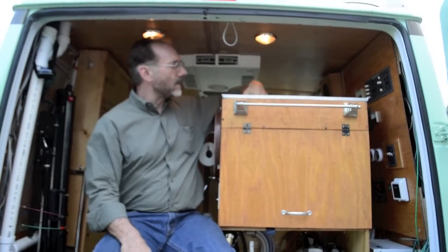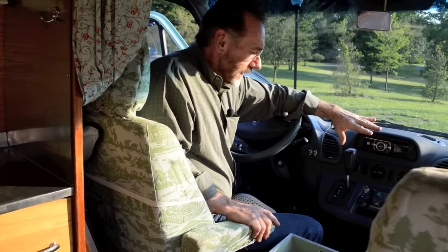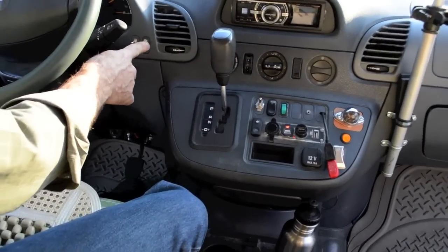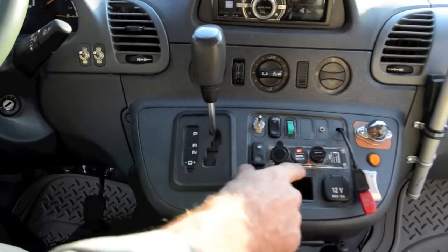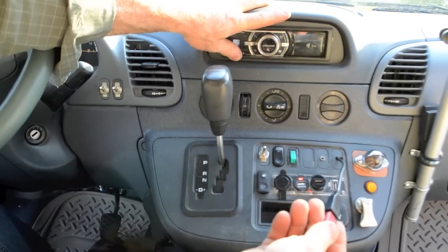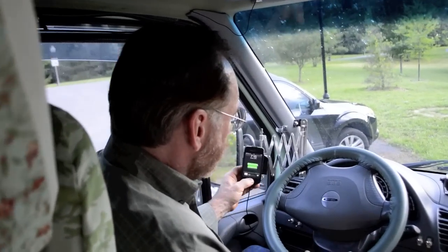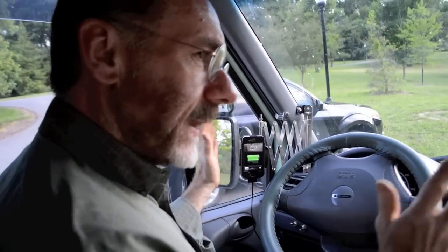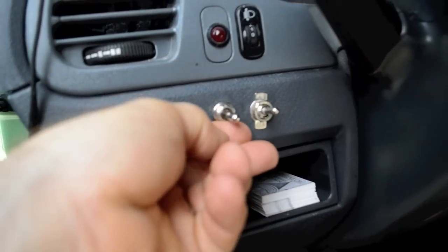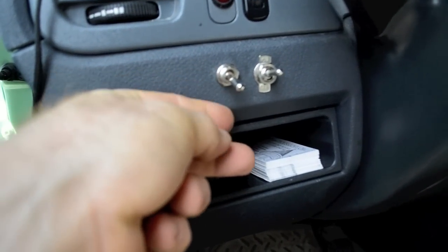This is a towel rack, and up here is cargo space where we carry extra stuff like TP and dog biscuits. We made sure to put every convenience we could in our console: floor lights, overhead lights, fog lights, and USB ports. The switch on the left is a really cool feature — it attaches the alternator to the rear battery bank for a quick charge, but it also allows us to start the car with the rear batteries if the regular starter battery ever goes dead.